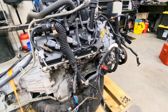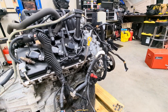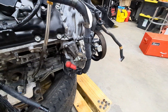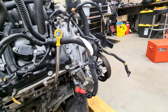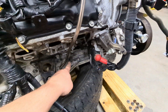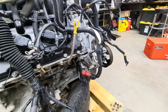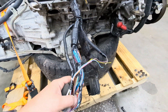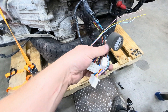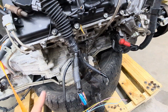I'm going to show you an alternate way to do your wiring on your VK swap. Common consensus is you have to use your alternator and starter sub-harness off of your Xterra or Frontier to wire things up properly, because on the Xterra and Frontier your starter sits down here, so your starter and alternator come up into one plug that plugs in on the side of the fuse box. On the VK, because the starter is actually in the back, its power wire as well as your oil pressure sensor run through the main harness and come up here where these plugs go into the IPDM box, and that power wire and oil pressure wire run through there and are separate.